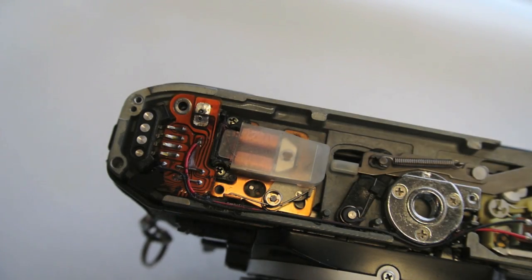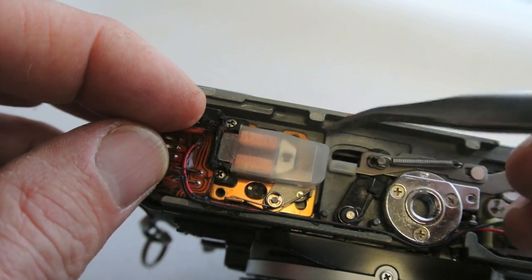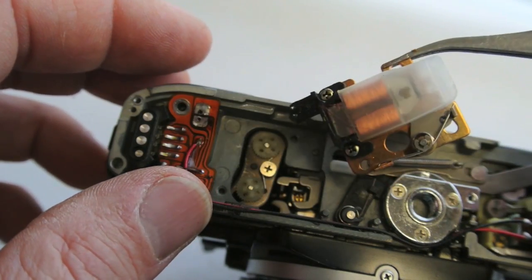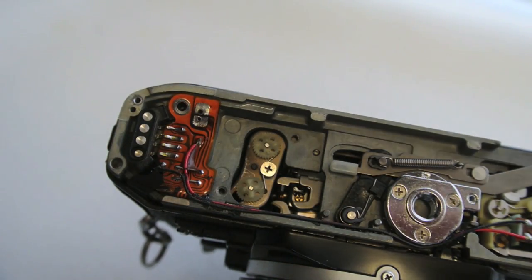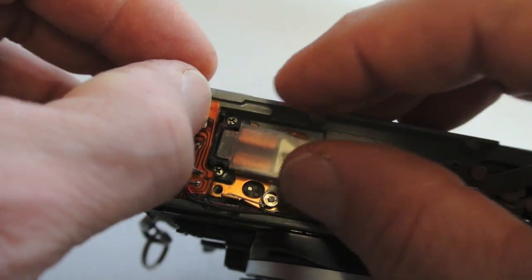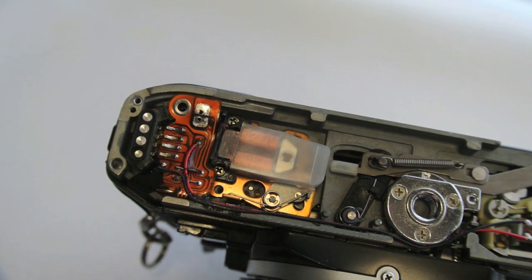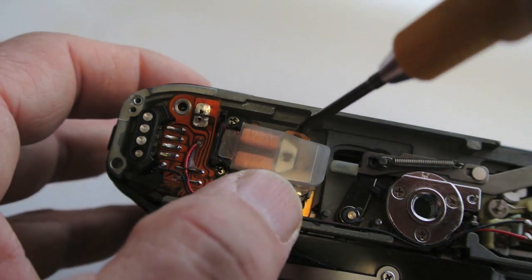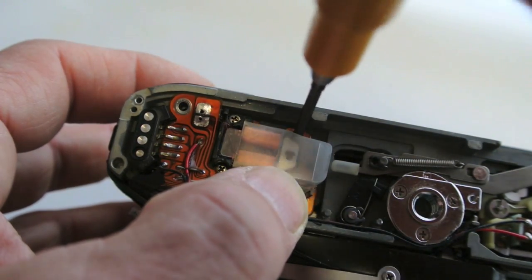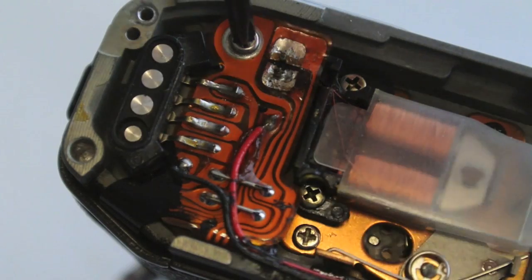Remove the ground screw and gently lift the flex circuit up away from the magnet. The three screws holding the magnet plate to the camera body should have already been removed. When installing the replacement magnet, take care to align the contact post with the holes in the flex circuit and gently press into place. Once the position of the magnet is satisfactory, install the screws holding the magnet plate to the camera body. Install the ground screw and, working quickly, solder the connections to the flex circuit.